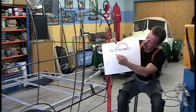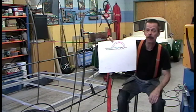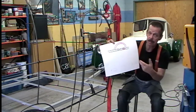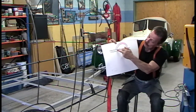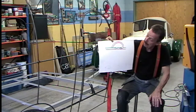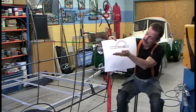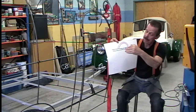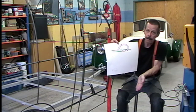What it shows is you have the door and the frame in green. The blue dots or rings are the framework we have right now — the bars. I'll be making hinges basically out of the same kind of bar. The red or pinkish thing is the hinge, and that's approximately how it has to look. It has to do two things: it has to allow the door to go straight out and not start to swing away immediately, because since it's a curved shape the side of the caravan it's going to catch. But if you can make it just move outwards before it starts to actually swing away, then you've done it.